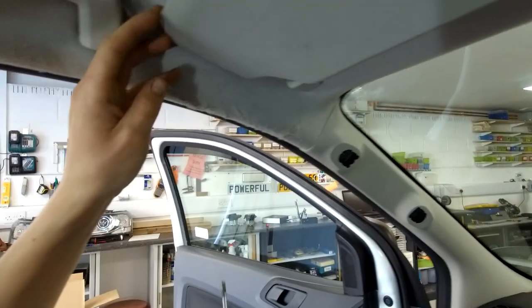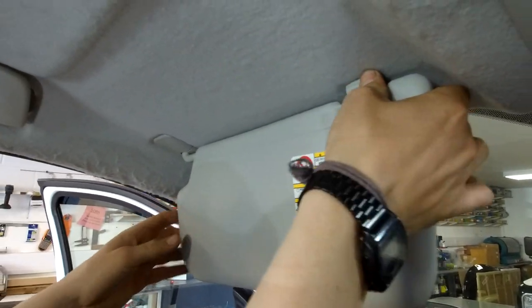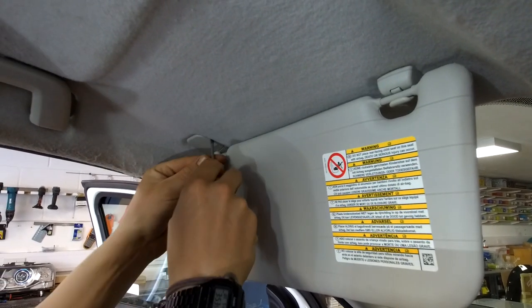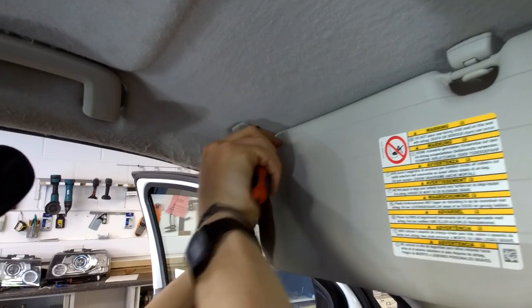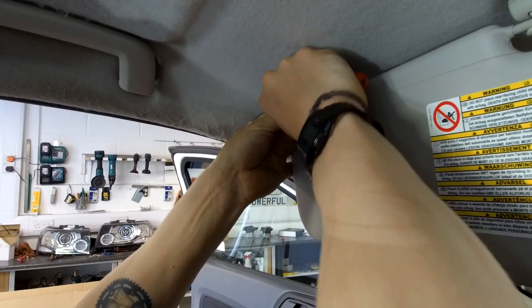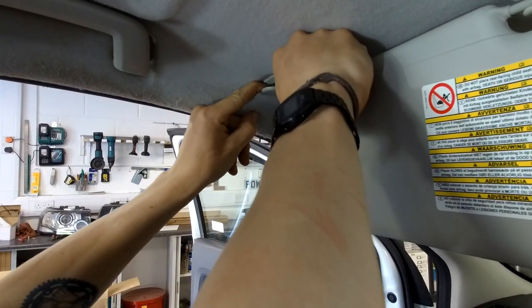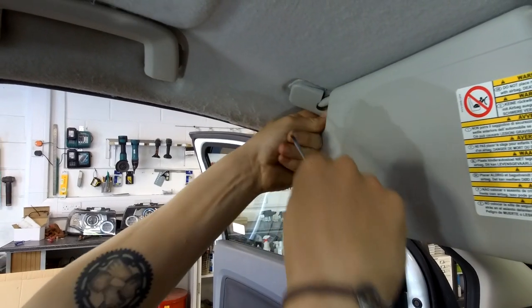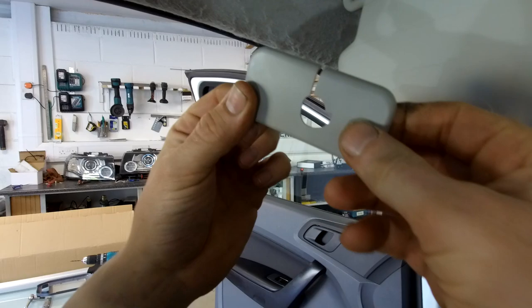Let's work in a logical order, front to back. The sun visor on this side can just unclip — no need to unscrew anything. The other side's got a cover on it which should just come off. If you're pulling it off with a screwdriver, just go under that little section — don't try to pull off the whole screwed-on part. It's got a slot in it so you just work that out.